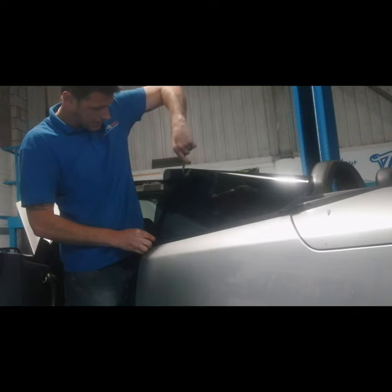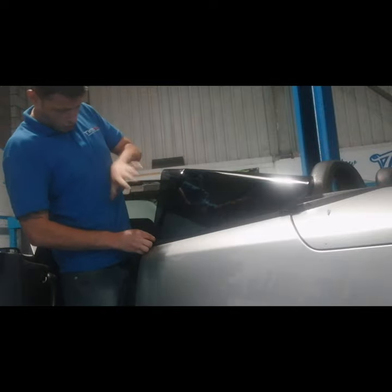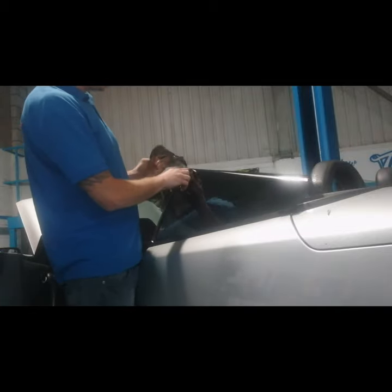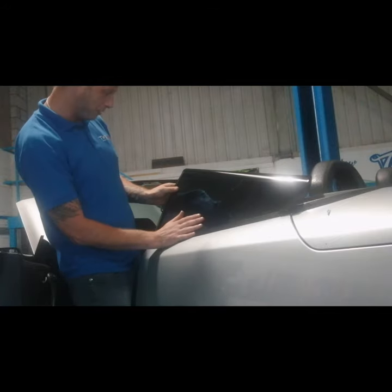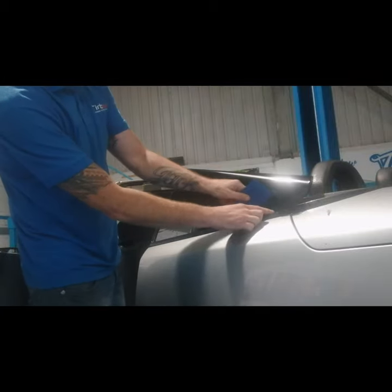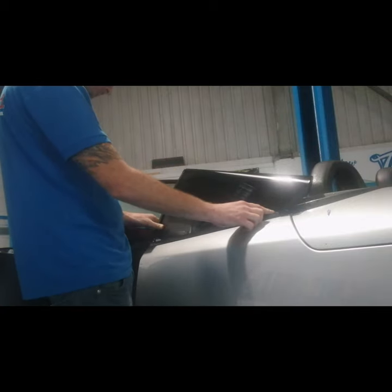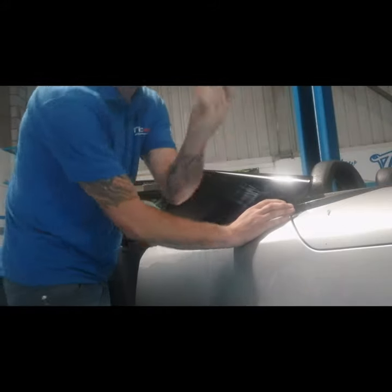If the tint is coming away from the glass, we have to push the tint back to the glass to make sure it's flat. If the tint is coming away from the glass when you cut it, you'll cut it short. Once we've made that shape, we tear away the excess, then we push away from the bar about two millimeters. Now we're going to lock the tint — we're just going to card it here. All we're doing is pushing the water out underneath, which causes the film to stay where it is.